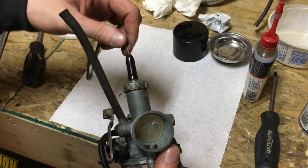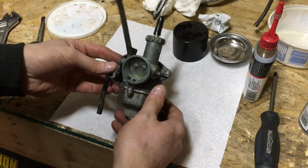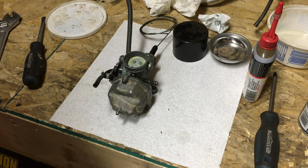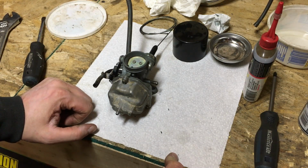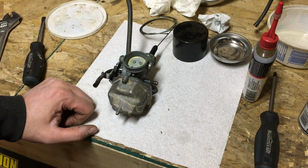So now that I've got the carburetor back together, it's nice, throttle assembly sliding nice. I think what I'd like to do next is get my tower set up for my gas tank on the test jig, and then we're going to have a look at the exhaust and see if we can mount the exhaust up temporarily with just that one post on it, or if we might want to wait until we can get the second post. That way we can get a good seal. I'll even have a couple copper gaskets so it seals properly when it runs. So let's have a look.